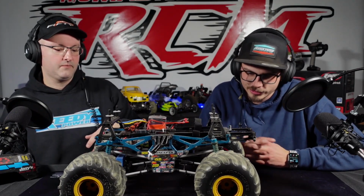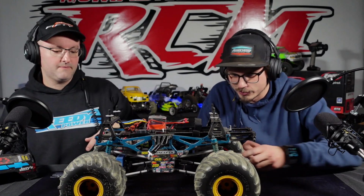And I mean, these trucks were stupid fast, but they had an Achilles heel. The axles are a little bit on the weak side. There's something pretty interesting going on there, the way they have the pinion mounted on the top. Yeah, so the drive shaft comes in the top. There's a couple of bevel gears, and then it goes down into the diff. It's not like a regular ring and pinion. It's kind of weird. More things to go wrong, really.